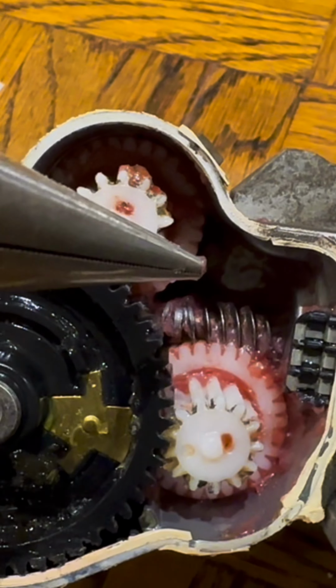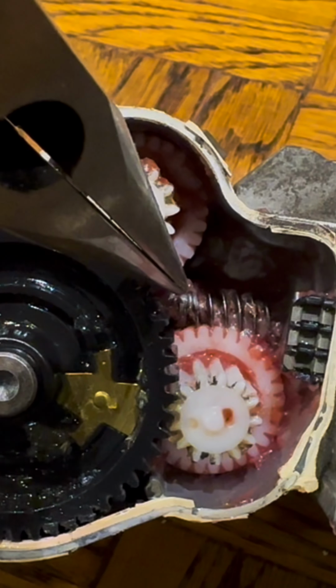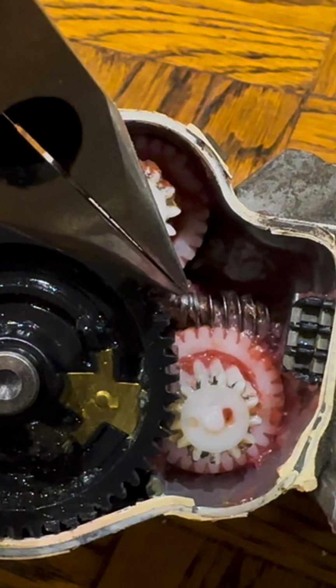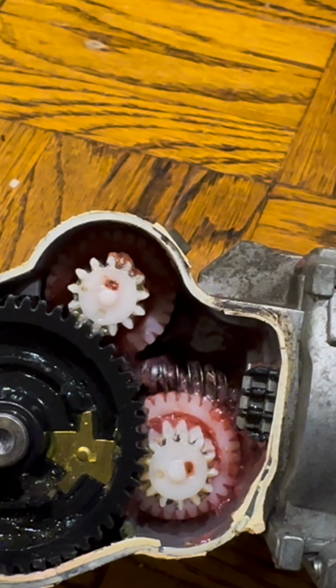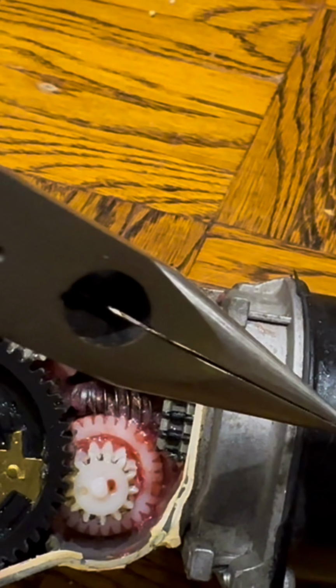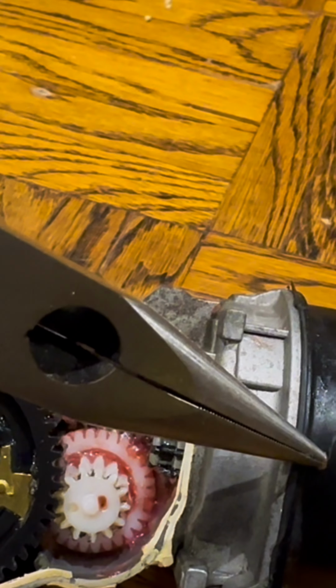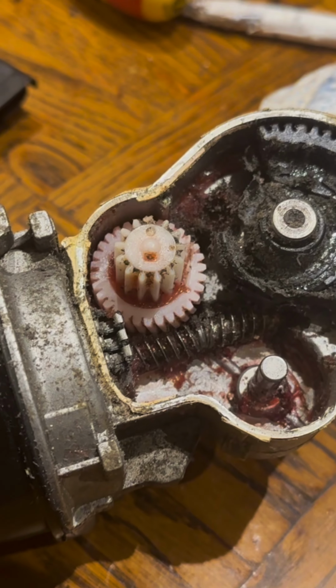But you can see there that this drive here, which powers these cogs, has got bent a little bit, it's distorted. So what I'm going to do is remove this and have a better look at this. I can't turn these cogs just now. I don't know if this is because this thing is not turning or whether the motor itself is providing the resistance for this to turn. So we're going to lift it up and see if we can get a better look at what's gone wrong.